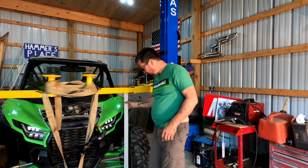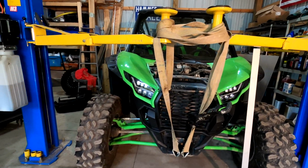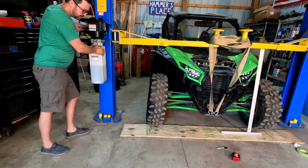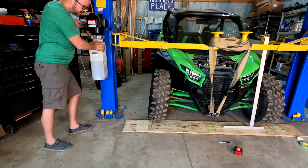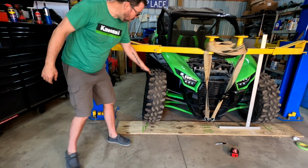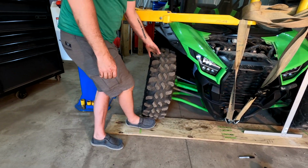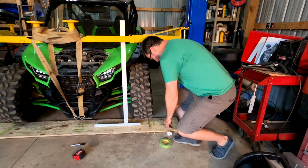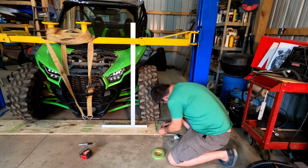Now let's go down, from the front I mean, to full droop compression. Tires aren't moving much, are they? There, it's starting to really camber in. Yeah, but the contact point is not moving. That's the important thing. Who cares about this? This can go wherever it wants. The point that matters is where the traction hits the road. And it did not move one bit. Actually, it's exactly the same.